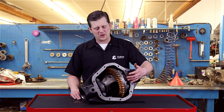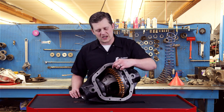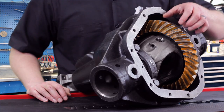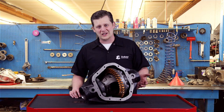When you're trying to read a pattern on a ring and pinion, what you're looking for is actually not the paint itself but the void in the paint — see where the gears wipe the paint off. You want to mark the gears in a couple of different spots. For clarity we've marked the whole thing, but in your case you're going to want to do two or three teeth in a couple of spots on the gear set, just to make sure the pattern didn't change in one or two places.